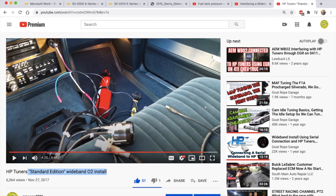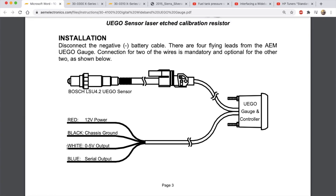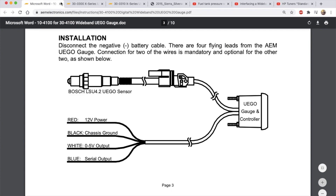It's the same method as this except we're applying it to a Gen 5 platform. How this works: you're gonna have your wideband hooked up and you'll need access to the analog output — the white wire on the AEM wideband. On the old-style gauge like the 30-4110 you have one analog output, or on the newer 30-0300 style you'll have a positive analog output (white) and a negative analog output (brown), so two wires to deal with.